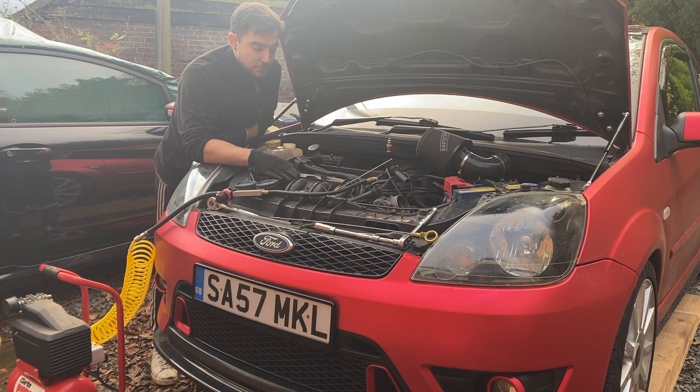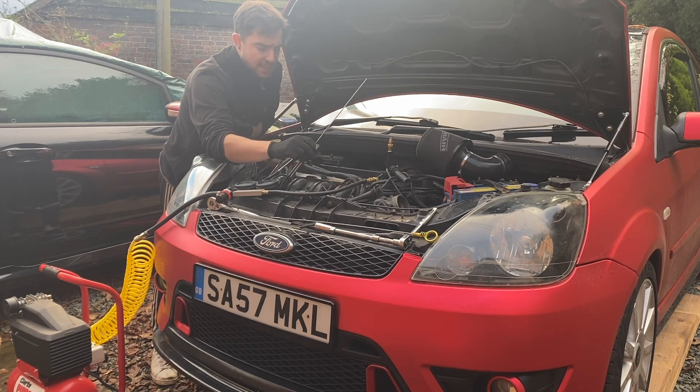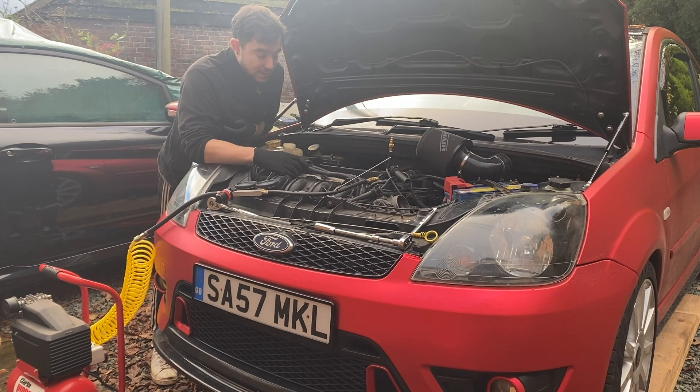So it's going to be piston rings, or maybe damage to the pistons or the cylinder wall, but most likely piston rings — which is really annoying because that's the bottom end, meaning a lot more work. I'm still really confused about cylinder two and I'm going to have another go at that one. I think it's going to be the same thing but it's just not evident through the dipstick tube. I think I need to let the stethoscope settle in the tube before listening, rather than moving it around. Either way, cylinder four — it's definitely bottom end.